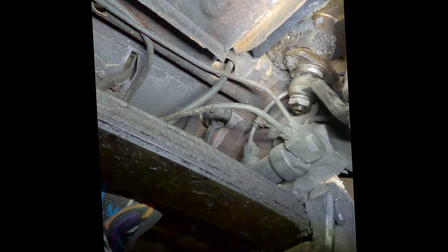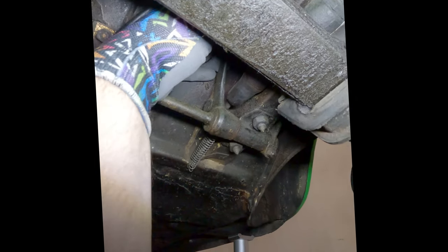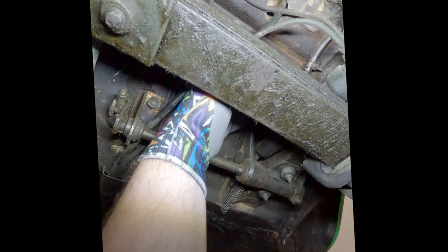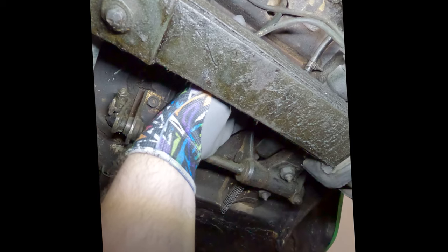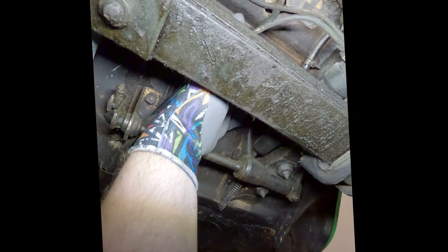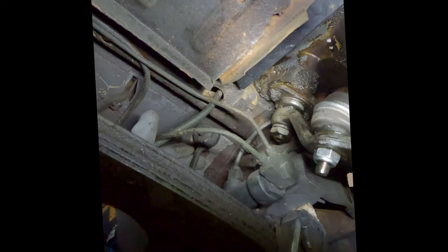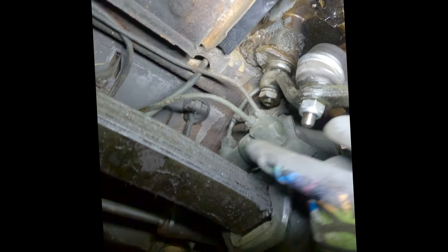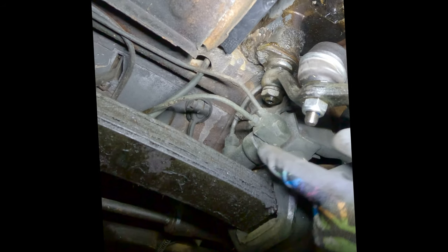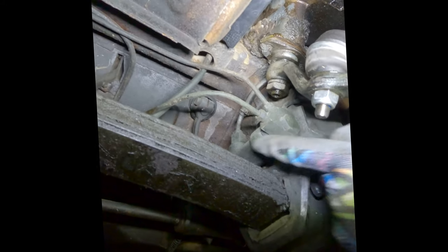This right here is your brake pedal, and I can actually actuate it with my hand somewhat. I would expect that to be stiffer and not actually be able to do that by hand. I'm going to call an expert and see if that's normal. Taking a look at where the rod goes into the master cylinder, I don't see any leaks there either. It could be that the seals inside are shot and it's leaking internally — just leaking past its own pistons.